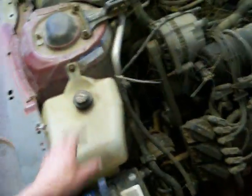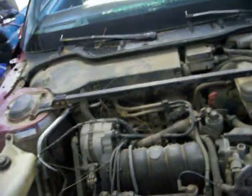What I'm going to do now is take out the battery and coolant reservoir, the air filter box and washer fluid reservoir, and I'm going to undo the fuel lines. Take off all the wiring and everything that's connected to the car. It's pretty straightforward — you look to see where things that are connected run to and you take them off. It's not really rocket science.